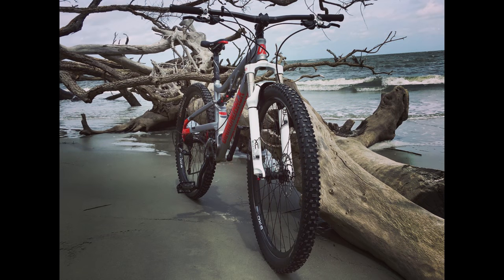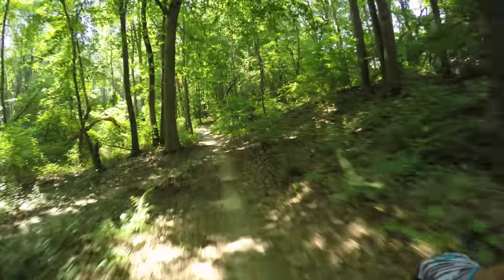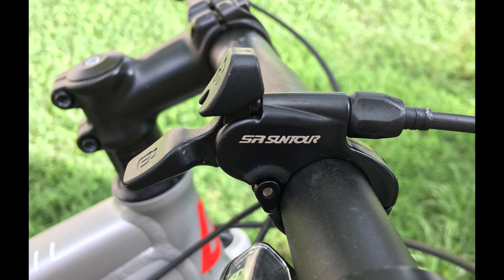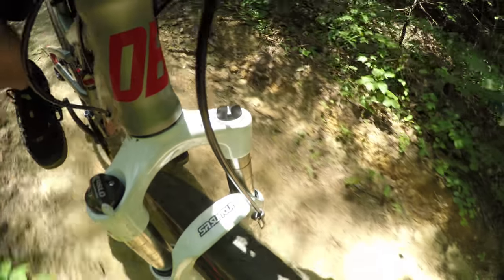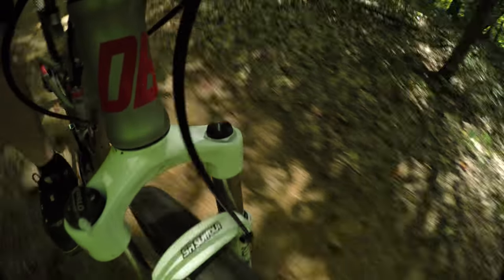Next is the air fork. Shortly after changing the rear shock it became clear that the fork needed an upgrade. I decided to go with the Suntour XCR fork with optional remote lockout. After taking the fork to my local bike shop to have the stem cut, star nut installed, and bearing race transferred, installation was straightforward. This fork is light years ahead of the stock fork in terms of handling. It rides smooth and with less jarring I can ride farther with less arm and hand fatigue. And an added bonus, it's also about 250 grams or half a pound lighter than the stock fork.